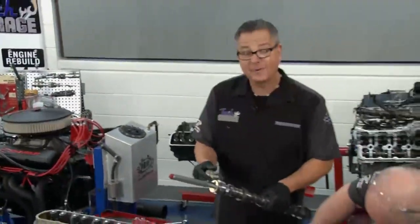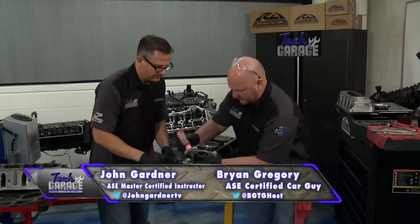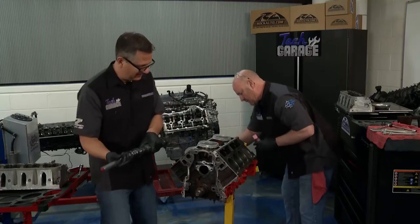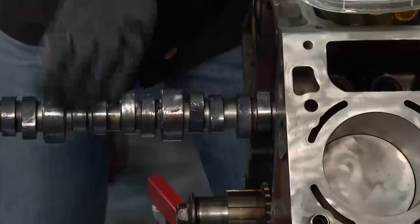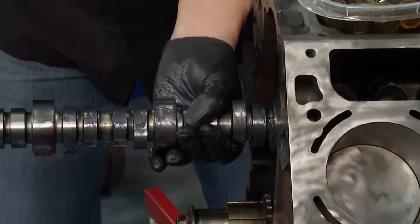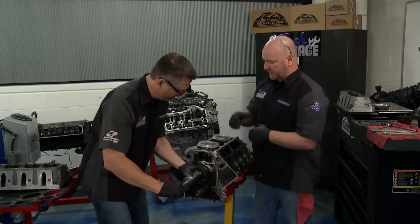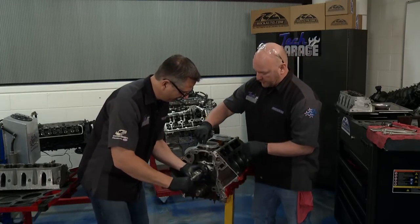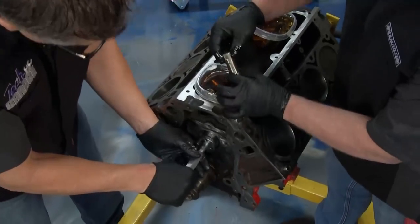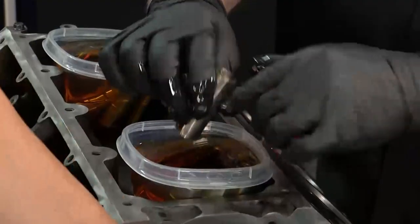Welcome back to Tech Garage. I'm getting the last little lube on the camshaft lobe. Got the front end lubed up, ready to go. Pre-lube kind of marries the camshaft to the lifters. If you have a new camshaft, you want to use new lifters. If you're using old ones, make sure they're all in order — you cannot interchange them. New with new, old with old. We let these lifters simmer all night soaking in oil. It primes them up, gets them super lubricated, makes the whole thing perform a lot better at initial startup.